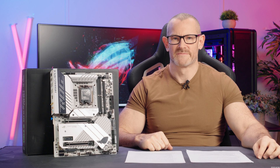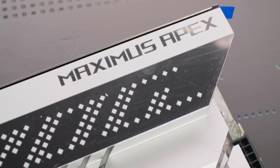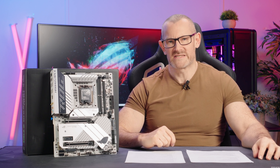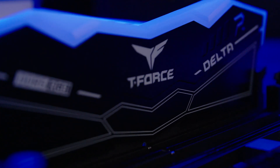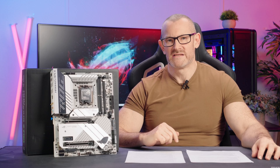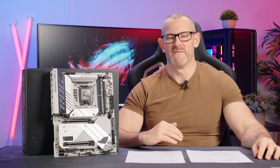Now let's discuss how I tuned the memory for this specific testing. I was working with 7200 and 7600MHz kits on the Apex motherboard. I noticed the new 13900KS has an officially improved memory controller supporting up to 8000MHz. My test conditions were that the kits must run at XMP voltage as stated and be at least 1000% MemTest stable — meaning this memory at that frequency will run your gaming rig day in, day out completely stable. Those were the conditions before proceeding further with testing.